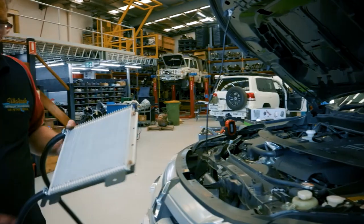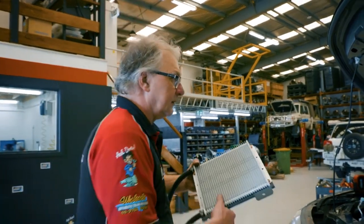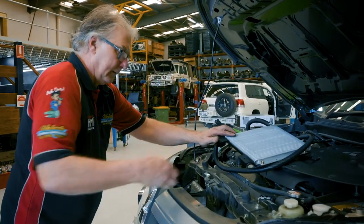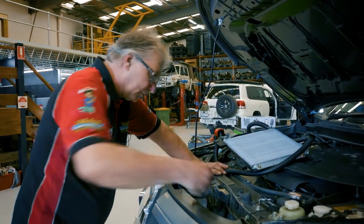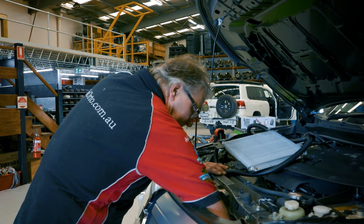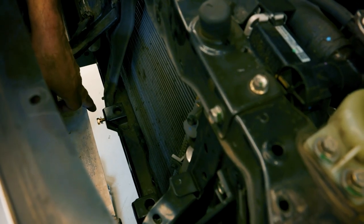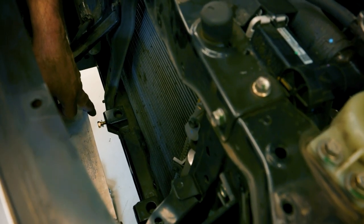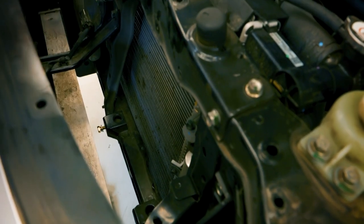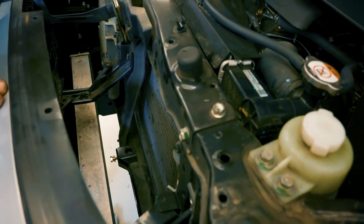Here's the cooler. You'll notice that one is slotted. Down at the mounting points, you put one bolt in so you can just slot the mounting bracket up. Here are the three mounting points — that one I've already pre-fitted the bolt so we can fit the cooler with the slot, one over there and the top one here. So we'll sit the cooler down into it.